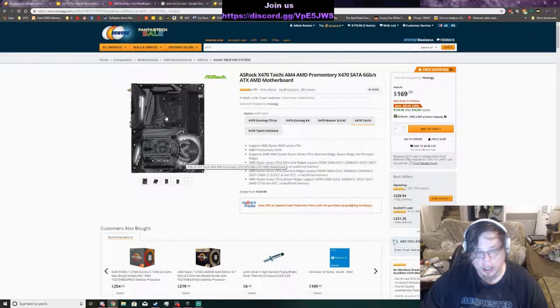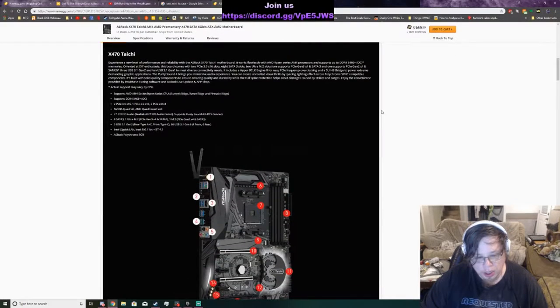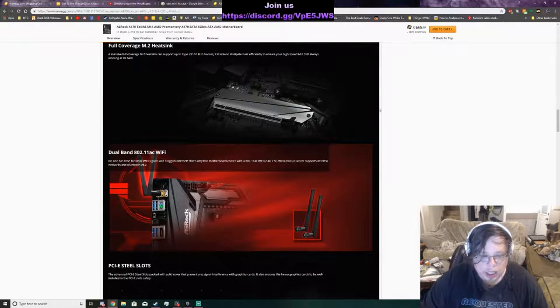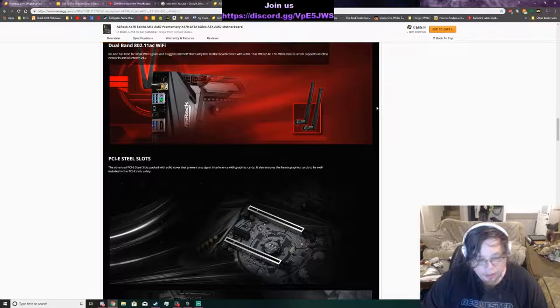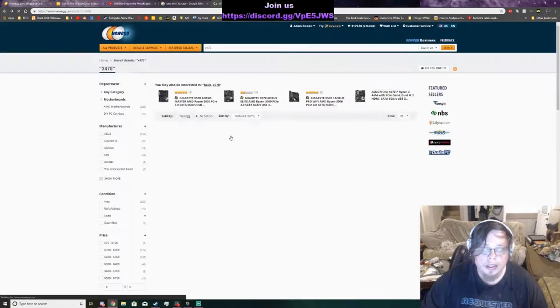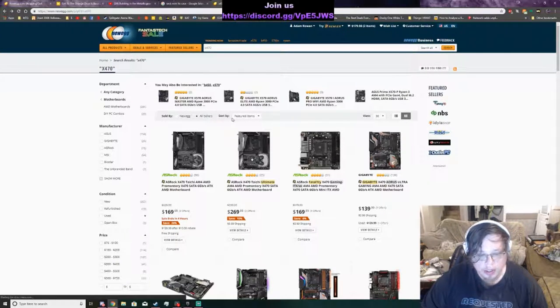Had no problem overclocking. RAM overclocking, I had no problem getting it up to, actually, I got it up to 3200. 3400 was mostly stable, but had a few quirks. But yeah, it's a wonderful board. I don't know much about overclocking either, so I'm sure if you actually knew what you were doing, you could probably push your overclock a lot more than I could. I think I'm running at 4.2, which is pretty normal for the 2600.